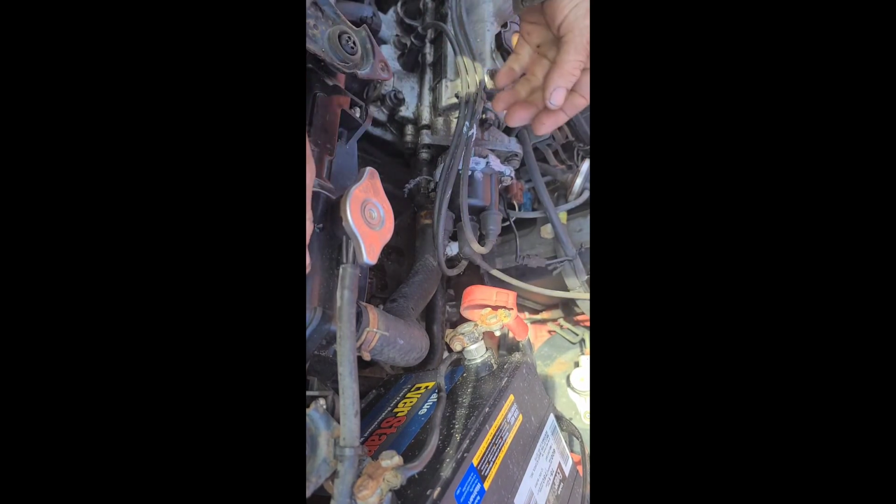Alrighty. Now that I think of it, I probably got a grounding issue, seeing that the horn didn't work. Probably didn't have to take everything apart. Seeing that the horn didn't work, and it seemed like I had to add a ground to the, there's 2 grounds on the throttle body. I don't know. I'm just kind of getting an eye on all these little vacuum lines, see if I see anything that stands out. This one had a hole in it right here.